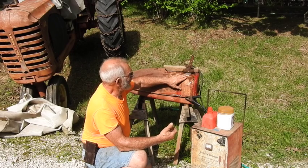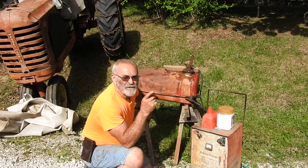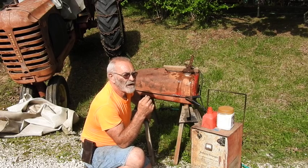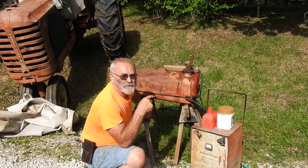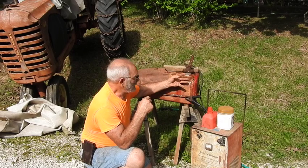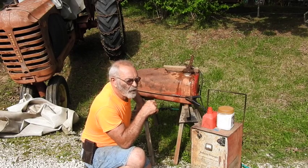We're going to let this set, and literally within three minutes you'll be able to see movement in that water at the top of the tank. Here in the morning this has been on all night long — you can see all this nasty coming out of here. Because this is the second doing of this tank, there's nothing but superficial rust on the inside and I want to get that removed to get it back to nice shiny metal prior to applying the gas tank sealant. So I'm going to go back into my archives and find some old video from May of 2020 to show what it looked like originally.